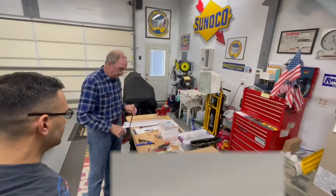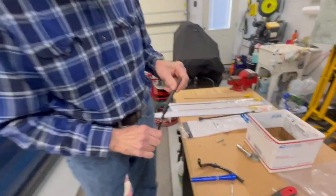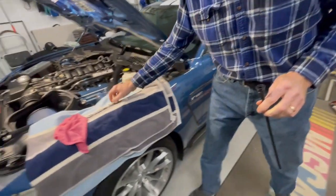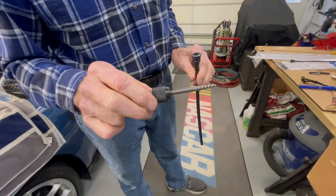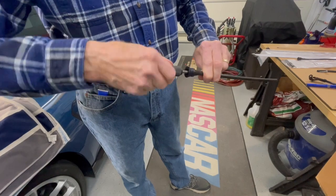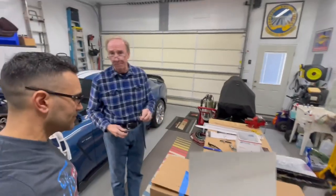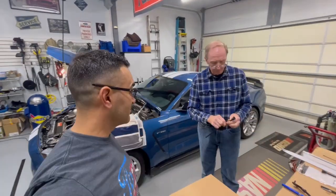And what I found works well, two things: you can try a piece of rubber tubing in there, packed in, and it'll grab it to turn it. Or what I really liked is I used a 5/32 easy out, and that locks right into the tube tight because it's left-hand thread, so it backs it out perfectly. So that should be the way to go, I think, but it makes it easier. You can get it out by hand. The first one we did get it out by hand. Well, we'll see how this works, and we'll go from there.